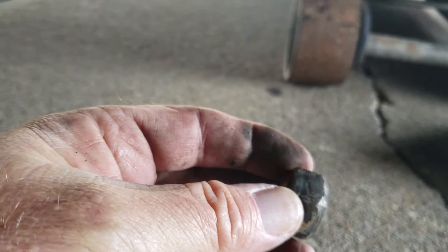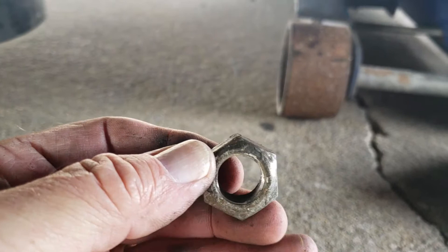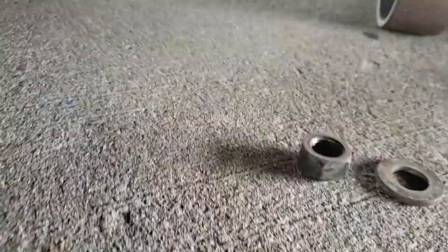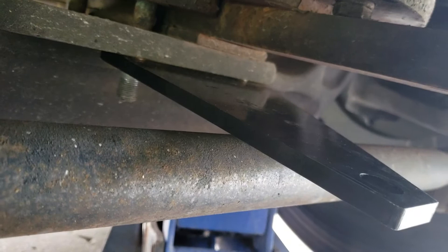These are fine thread bolts — there are two of them. They come with a washer and a nut. You have to make sure this end always goes down. There's a little crowned end here — it's almost like a lug nut. But with this one, the flat end goes up and the recessed end goes down. Then the washer goes on top of it, and that goes back up on the bolt you just took off. The angled end faces toward the tire.